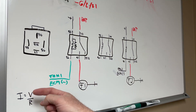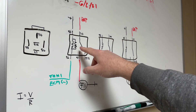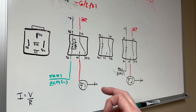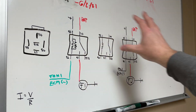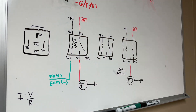This resistor — and sometimes they use a diode — absorbs that current so you're not shoving power back down the negative line and potentially damaging your ECM. A diode will physically block the current from going back that way. So you typically want to wire 85 as positive and 86 as negative. That's basically how a relay works.